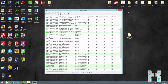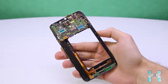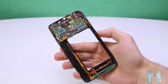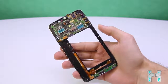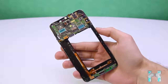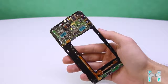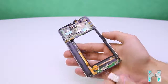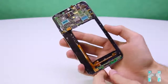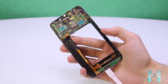Now let's get the smartphone recognized by the computer. What we are trying to do is bring the smartphone into META mode. META mode is a different mode of the preloader which bypasses the actual preloader and allows you to re-download the preloader and then re-download the whole ROM. META mode can be triggered on most China phones by holding volume down while you connect it to the computer.